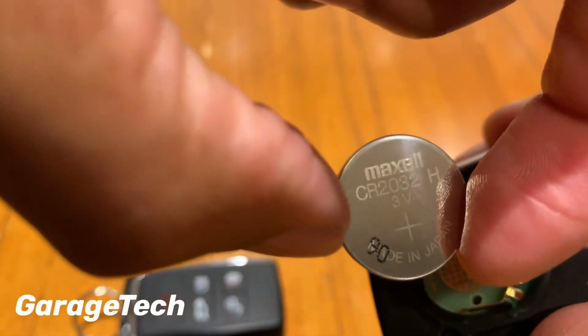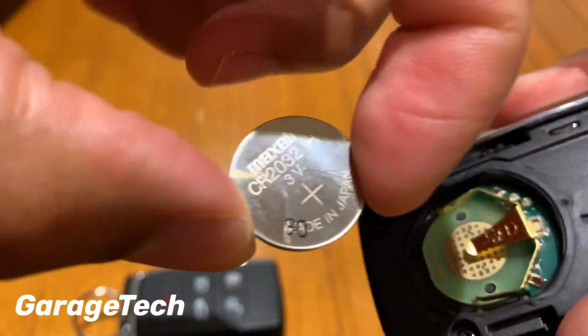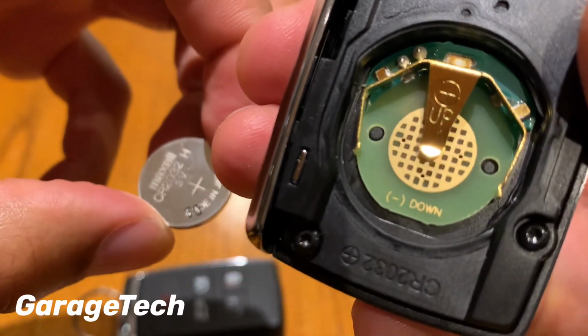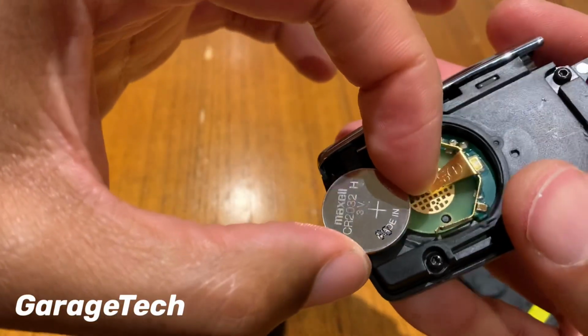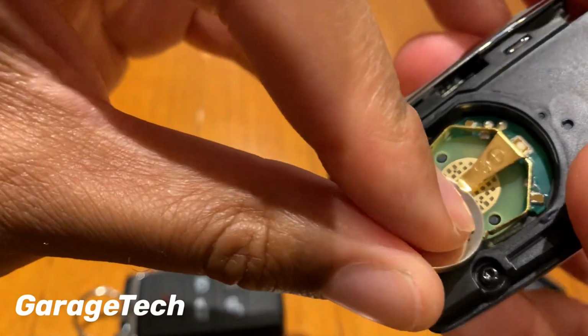It says CR2032. So that's the positive side is up, as it says on the key there. So the positive side up, negative side down. Just be careful when you handle these batteries. You don't want to touch the top and the bottom at the same time, so it's probably best to wear some gloves. And then with your new battery, all you need to do is then slide it back in